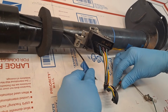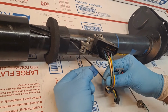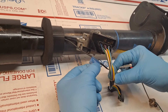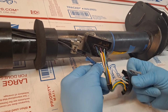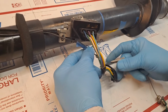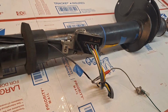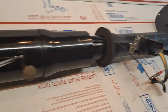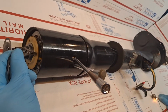In fact, before I do the turn signal, I'll go ahead and test the horn. The horn has been left out and it's marked and labeled as such, horn. The pins have already been primed so they can go in either of these 2 vacant connectors for the 9-pin connector. Okay, so I'll just go ahead and connect my wire. Then I'll take my power and I'll touch the contacts right here. And we can see that the light bulb comes on.